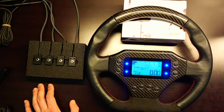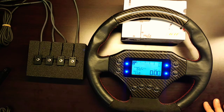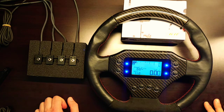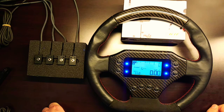This is a great working system for open wheel vehicles, time attack cars, or even supercarts. The D-shaped wheel with a flat bottom is a nice aesthetic touch. The EVO 4 has five additional analog inputs beyond what the IR temp sensors already use — since those are expanded via a channel expansion — providing five dedicated inputs for any analog signal between zero and five volts. That concludes the summary and general overview of this AIM EVO 4 data logger system with GT 320 steering wheel and IR temp sensor kit.